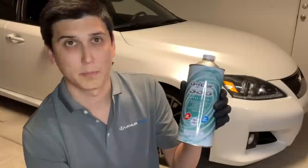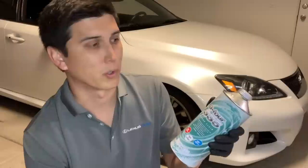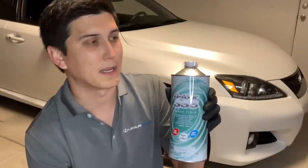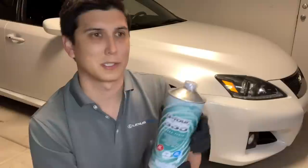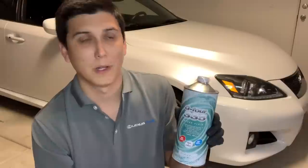What's also kind of cool about this brake fluid is that it comes out green, and then when it's reached its usable life it'll turn crystal clear. So you can just pop off your brake fluid reservoir, look in there, and say 'it's not green anymore, it's clear — time to change it out.' That's a cool built-in indicator. I don't know of any other brake fluid that the ISF guys use that has that kind of feature.